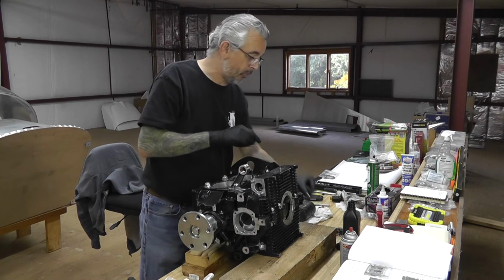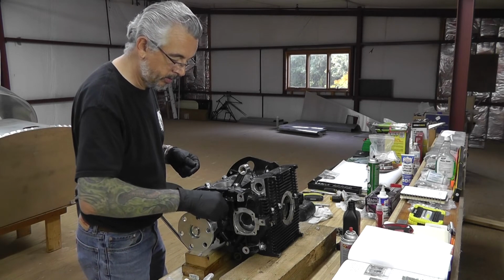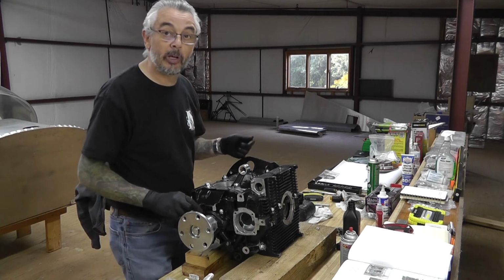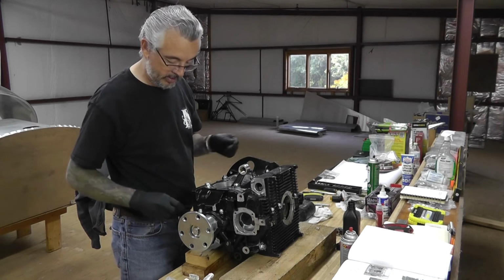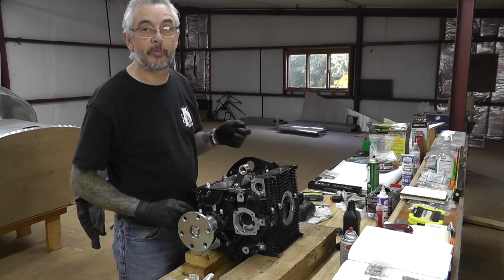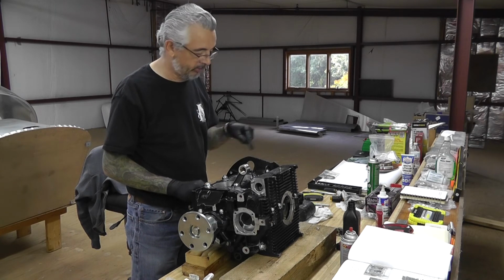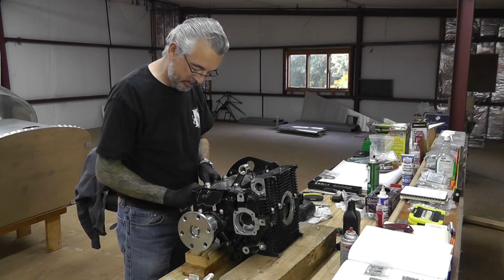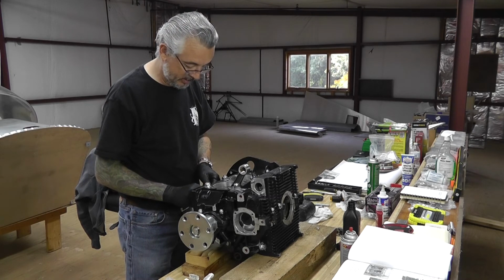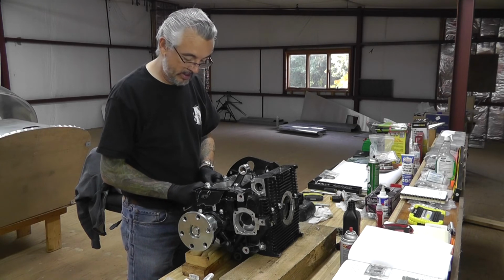I need to Permatex under those cam washers. I almost forgot that. That's what's helpful about watching the Aerovee assembly video a few times, reading your book a couple times, and then again before you're ready to assemble, and then as you start to visualize specific bolts, there's a fair chance you're going to remember something from the book or the videos that would pertain to that particular area. So I forgot about that till I looked at those, and then it was perfectly clear.